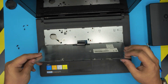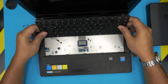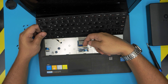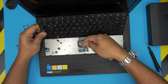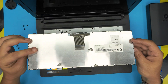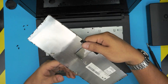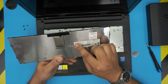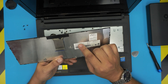Place the keyboard face down. You'll see the three screws that were removed and the ribbon cable connector. To remove the cable, put your finger at the back by the black plastic rod, unlock it by bringing it to a 90-degree position, then slide the flex cable backward. The model part number for this Lenovo keyboard is 25214517.